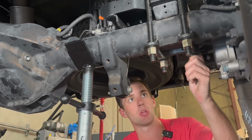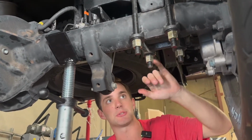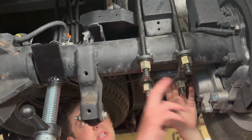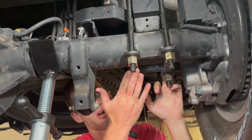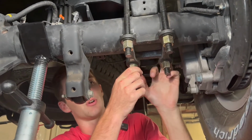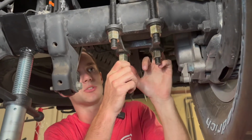So next up, we're going to be mounting our underframe adapters or under axle adapters. There's a few options. This is a 250. It's a 250 350 truck, so we have a plate that just will go right above these bolts. So you leave the bottom plate installed, and then we have our under bottom plate. It's going to be a 10-10-41 for the 250 350 trucks. For the 450s, it's going to use a 10-10-42.